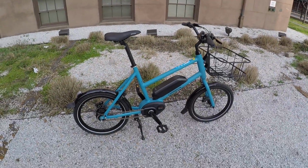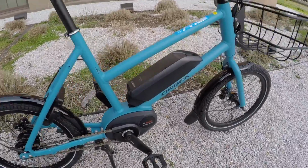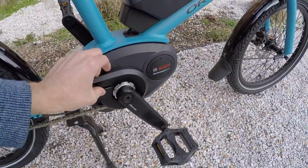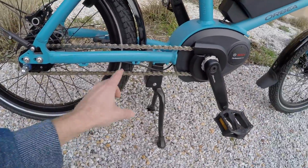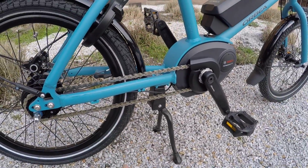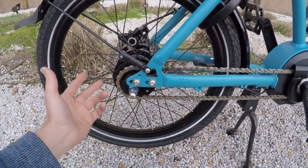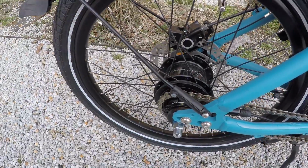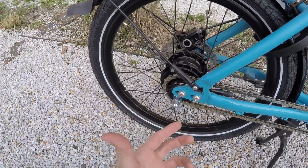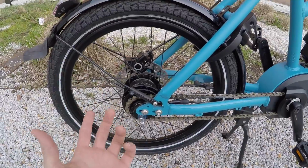You know, room for a little improvement, but otherwise I think this is a very cool and unique bike. I love that they managed to squeeze in a plastic chain cover because I'm riding with my pants tonight. You don't want to get those dragging on the chain. The chain is very tight and maybe a little bit stronger, sturdier than if this was using a traditional derailleur and cog set. It's only got one sprocket in the rear, one sprocket up front, and all the gears are inside. That's a Shimano Alfine 8-speed internally geared hub. They tend to weigh a little bit more, but they stay clean. They can be shifted at standstill.